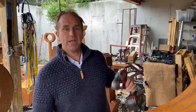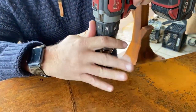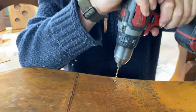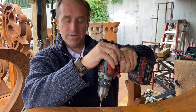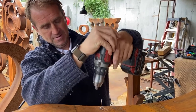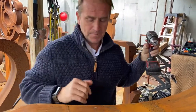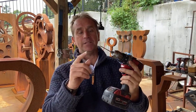When it comes to drilling the holes, I like to start with a small pilot hole and get it right in the center of your marks. Using a smaller drill bit to start will help keep it from walking around and make sure you've got it in there good. Then go through and do all six holes, and after that bump up to a larger size drill bit.